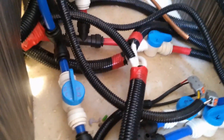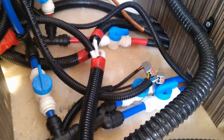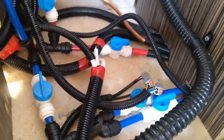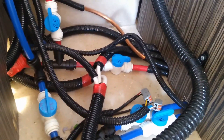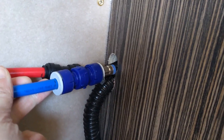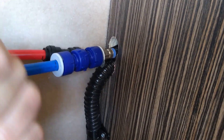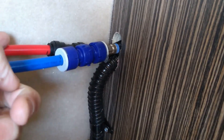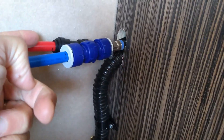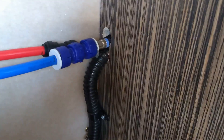Every item — like the taps — will have stopcocks for hot and cold. It's a bit overkill you might say, but if you use the van a lot, the taps are leisure items designed to be used two weeks a year. If you use them for a thousand nights, they will wear out and they will leak, so it's worth doing. For the hot and cold at the bathroom sink, we've got a one-way valve on the cold. That basically means that if you have a mixer tap with a trigger, if you've got the tap on and the trigger off, the hot can come down the cold because the hot will be under slightly higher pressure, and then when you squeeze the trigger you get double hot and you get scalded — only for a fraction of a second, but still.